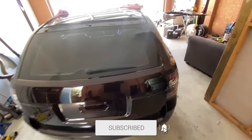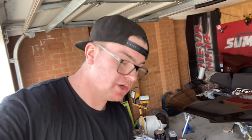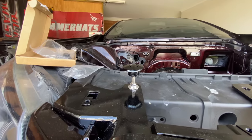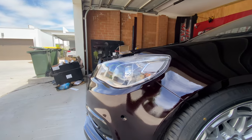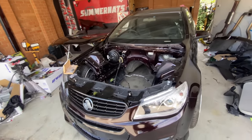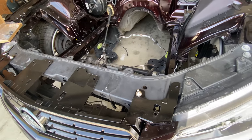I haven't put the lock on it because obviously without power I won't be able to open it. So what I'm doing at the moment is measuring out where I'm going to put the hood pins for the bonnet. I've found a pretty cool place where it's actually the same thread pitch as the hood pins, and it'll also help holding up the front bumper to look a bit better too. I've got these perfect spots exactly where I wanted to put them. Now I'll take these off, put a tiny bit of toothpaste on the top of these, line the bonnet up as best I can and just dab it on so it just leaves a little mark. And then I can do the scary part of drilling into the bonnet. It is rather intimidating because you can only really do this once, and there's a lot of reinforcement on the bottom side of the bonnet that I obviously have to cut out, which risks cutting through too far. I just hate doing this stuff, but it will be all worth it.